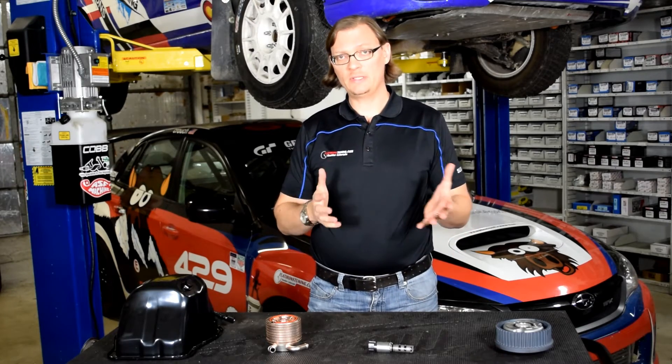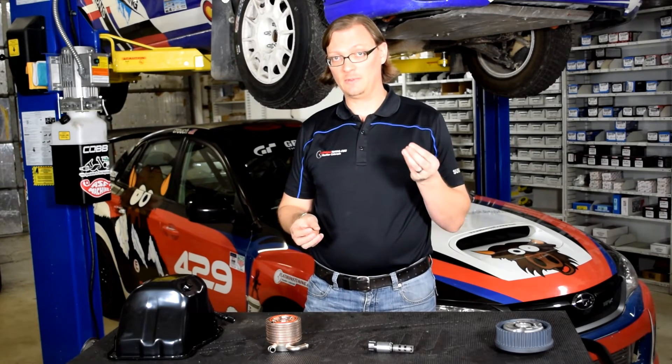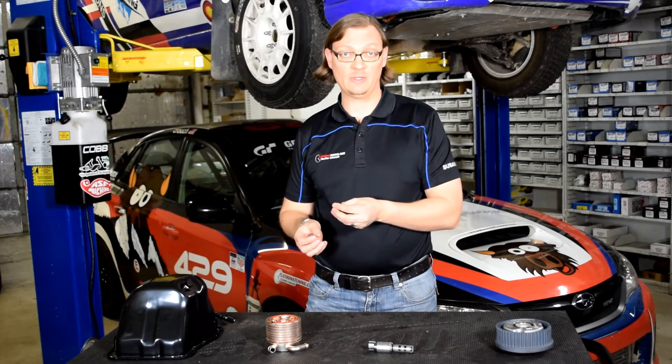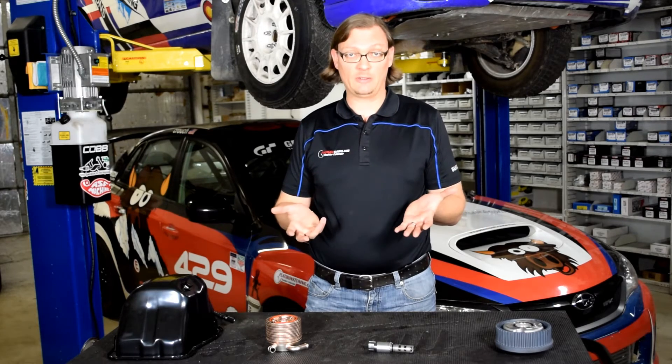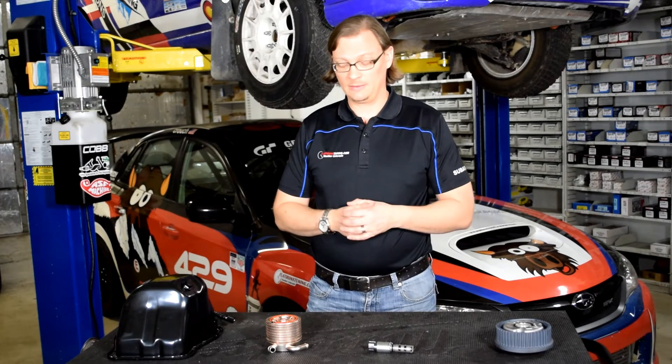This is so important because if you have metal contamination that you transfer from one part onto the new engine, you can replace everything else, but if that metal contamination is hiding in one of these parts that you move over to the new engine, it can take out a brand new block very quickly. There are some things that are kind of gotchas that you want to look at and replace, and I've got a display of them here.